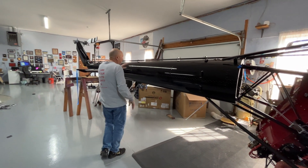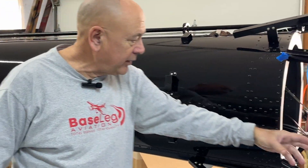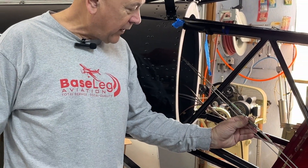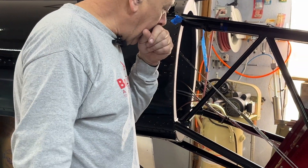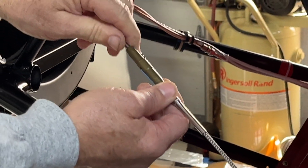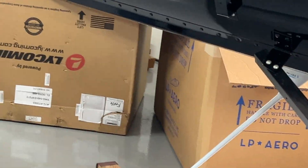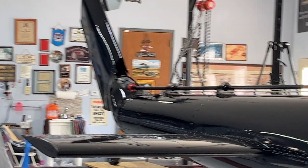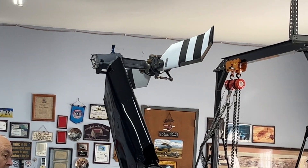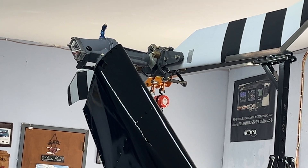It's all installed. We've got the anti-torque cables set at 45 to 50 pounds as the book specifies — I got them right in that range. You can see the turnbuckle with clips rather than safety wire; I like using those clips. These are all set at 50 pounds each. The antennas are all wired and working, the tail strobe light and nav light are working as well. And the tail rotor is on with all blade angles set.